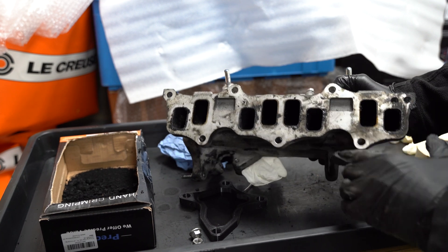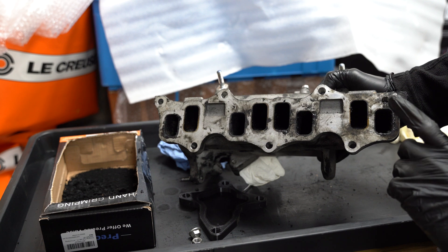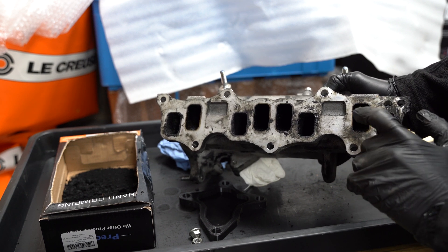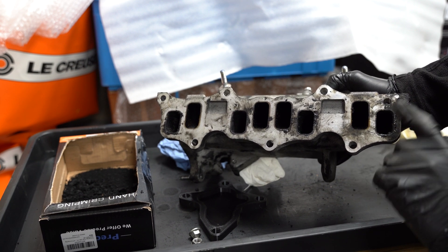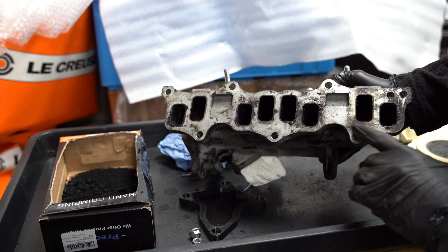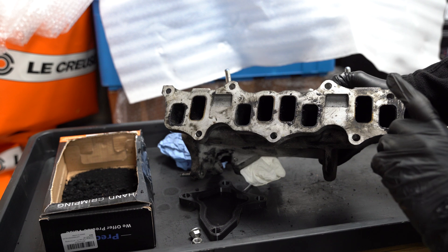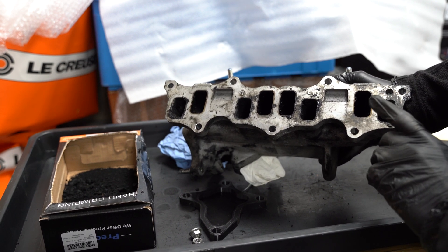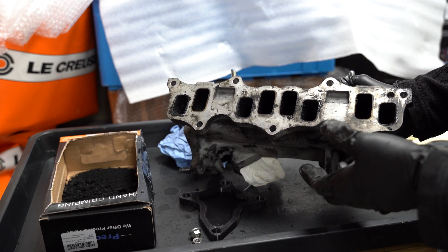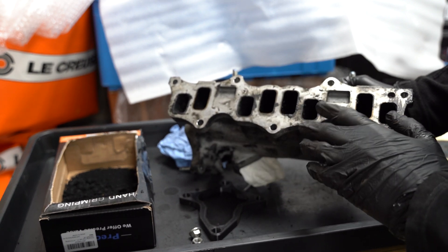Also on this engine I've seen something for the first time: one of the ports for cylinder number one was completely covered by soot. So that cylinder was working with air only from one port — including the valve, everything was completely covered with soot. This is a car with 145,000 miles. The carbon buildup is something we cannot avoid, especially because this car has been doing low miles and didn't have time to warm up. But once you get this type of buildup, your driving style doesn't really matter — the intake is compromised.